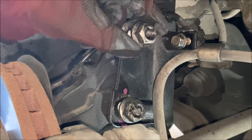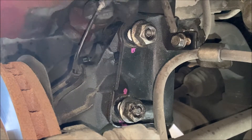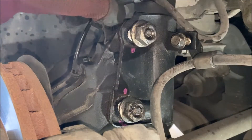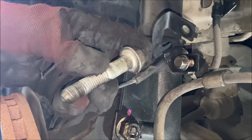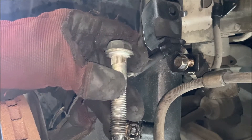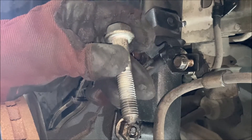If you're going to use the punch technique, extend the nut out a bit more so only a couple of threads are engaged — that way your punch isn't going to hit the threads of the bolt. Also, be careful with the speed sensor line here; don't hit it with the hammer, and same with the brake line. Just be really careful around these lines. The bolts have serrations at the end that press into the knuckle, so you definitely need to give them some motivational force to get them out — you're not going to extract them just by pulling by hand.